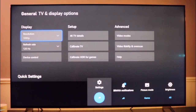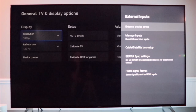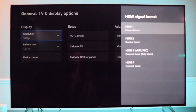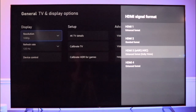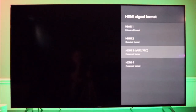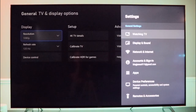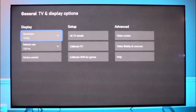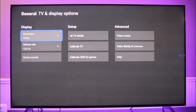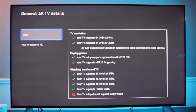However, if you have a Sony X900H, which is an HDMI 2.1 TV, go into settings, hit watch TV, and go down to external input. Scroll down to HDMI signal format — you need to have your PlayStation 5 or Xbox Series X in HDMI port 3 or 4. Switch to enhanced format without Dolby Vision; this is what supports 4K at 120 and is what's been stopping your TV from running 4K at 120. Select that and back out, then go back into your video settings on your Xbox or PlayStation 5. Now you can enable 4K at 120 — go to the 4K TV details first and confirm that your TV supports 4K at 120, which you can now see is checked. Then set it to 4K and it will maintain 4K at 120.